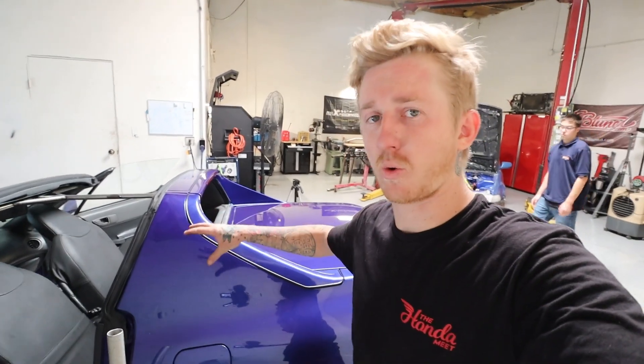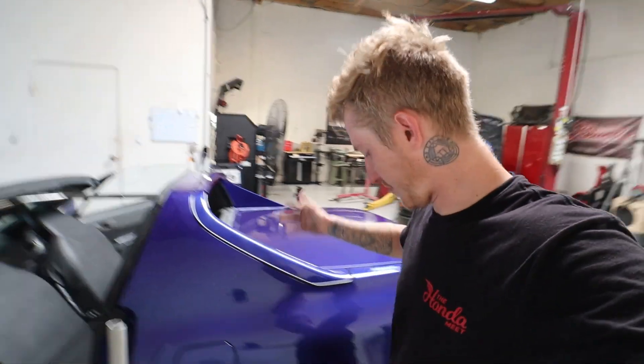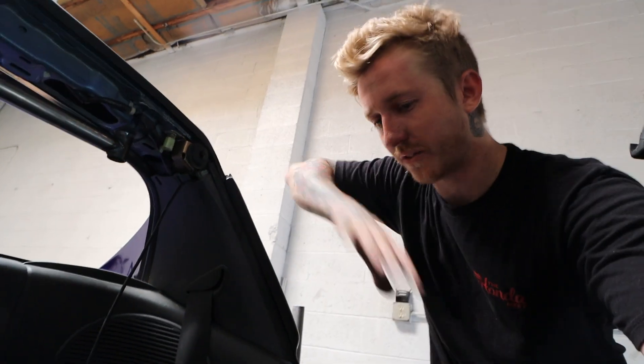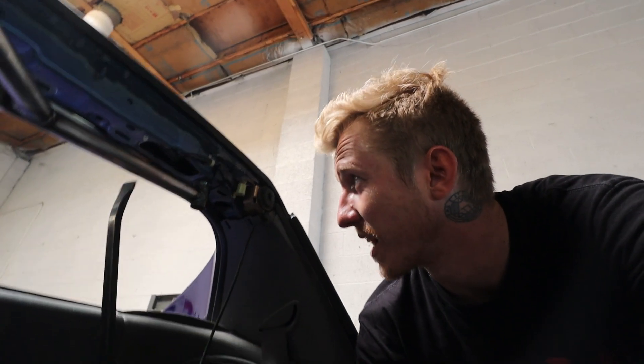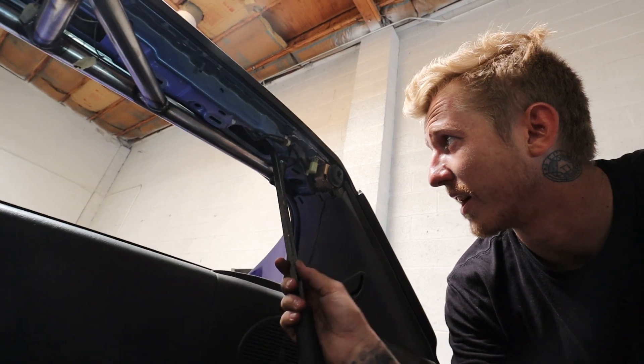We got it in — two points back here, two points up front. Now the fourth corner, as I mentioned, does pull in. What we did was take a jack and jack up that corner about eight inches or so. Your car may have more flex; this car has a lot of aftermarket suspension, so it may have a little bit less. Then we grabbed a pry bar, tucked it up there, and just pried against it. It is definitely a two-man effort unless you get lucky and your car's set up just enough for the holes to line up.